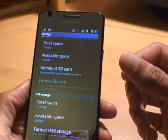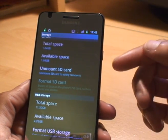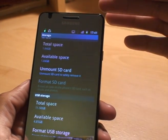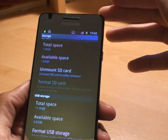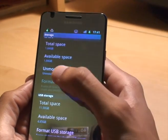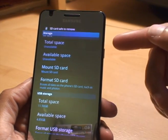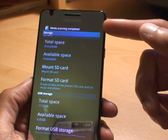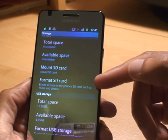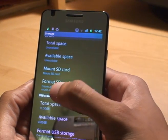You can't overwrite a database if it's currently being used. So if the card is mounted, that means the phone is using it and you can't overwrite all of it in one go. So you need to disconnect the card from the phone essentially, and then format it. The way we do that is we select Unmount SD card, and it says SD card will be unmounted. Give it a couple of seconds — it then changes the option from Unmount SD card to Mount SD card, and you can then see Format SD card is now enabled. So what we want to do is press Format SD card.